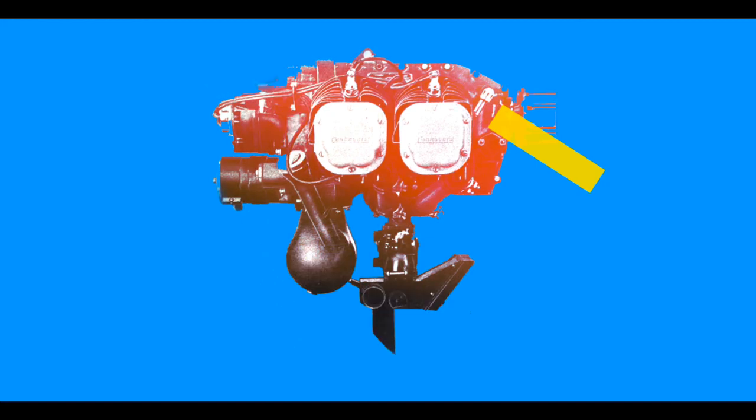That's where this heater comes in. The Twin Hornet heats from the top down. The aluminum and steel inside the engine then heat the rest through conduction — not fast, but very efficient. As you can see, the top of the engine always stays warmer than where the moisture is in the oil, so we never have a situation where we're evaporating moisture from the oil and condensing it at a cooler part of the engine. In my testing, the Twin Hornet does heat the oil a little bit as well, but that's not the primary goal.